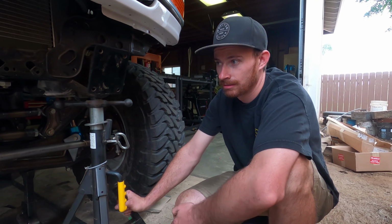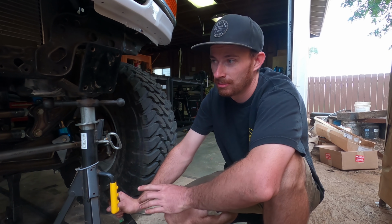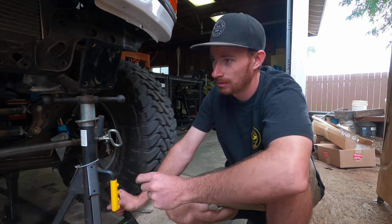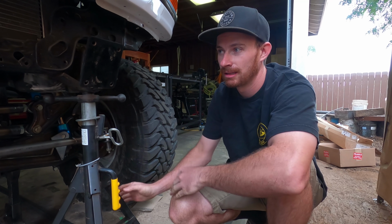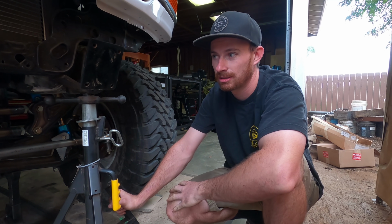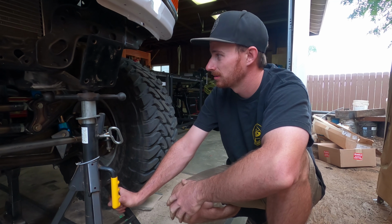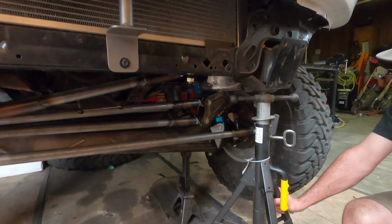Yeah, it didn't work that great. I think towards the end of having that set up on this truck, we were starting to bend the tabs that the bolts were mounted to on the beam side. So I think what we're going to do is some sort of thick piece of plate that the spindle will come over and hit, and then that way there's no chance of a tab bending or anything like that and changing where the stop is actually at on the steering. So it just needs to be a really fixed point. So we're trying to figure out how we're going to do that still, but that's something you're going to have to deal with. I won't really be involved in that.